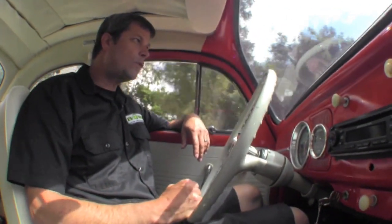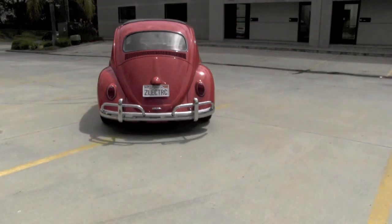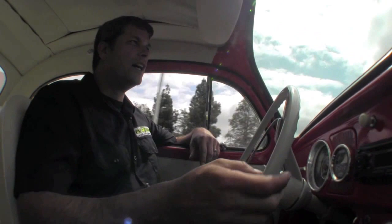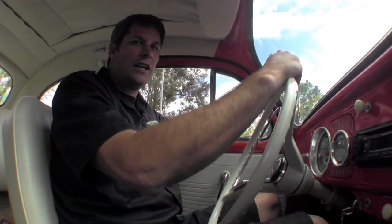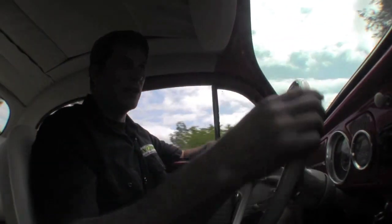Online we get a lot of questions that people ask about transmissions and why we like them, why we use them. We really prefer a car with a manual transmission. That way you can adjust the gear to the speed that you drive and the amount of torque that you need at the moment. Generally speaking, you kind of just leave it in one or two gears, usually second or third. These little AC motors are so torquey, you can actually start off in third gear, which is kind of nice. That way you don't have to shift, you don't have to worry about using the clutch. We have customers that don't even know how to use a standard transmission and they have no problem driving an electric car. So here I am in third gear — I'm just going to give it gas, we're going to cruise away. There's just no lack of power, no lack of acceleration. Third gear will take you all the way up to 60 miles an hour in this car, so really not much need to spend a lot of time shifting and finding that perfect gear.